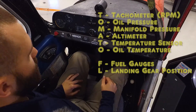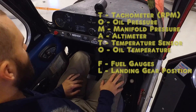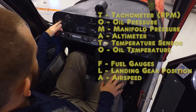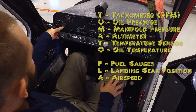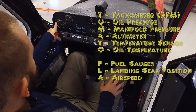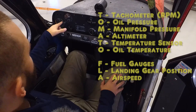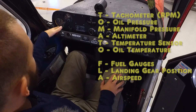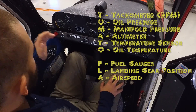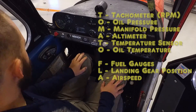After that is our landing gear position indicator. We're flying a fixed-gear airplane — we don't have retractable gear on this Citabria, so the gear is down and locked every time. Pretty simple, so no gear position indicator required. Finally we have our airspeed. Over here on the far left we've got the green arc going from stall speed at 50 mph up to 120 mph — that's the normal operating range. The caution range runs from 120 up to 160 mph — that's your yellow arc, non-turbulent air penetration speed — and our red line is at 160. When we're doing aerobatics, we commonly work in the 120 to 140 mph range. It does have knots on the inside gauge, but the outside is miles per hour, which is what we use for this aircraft.